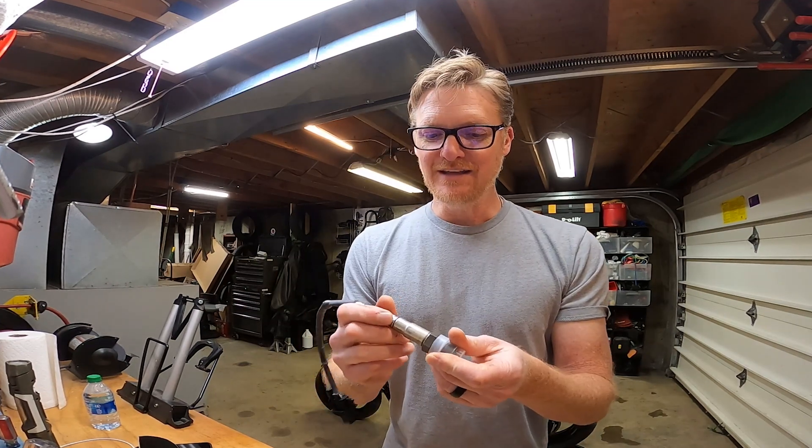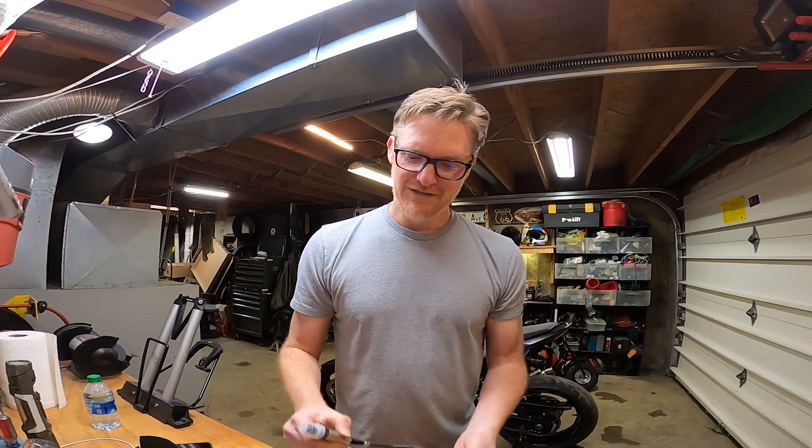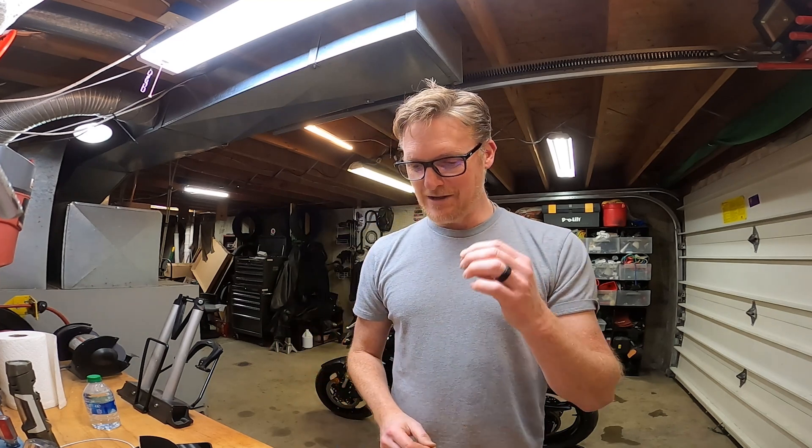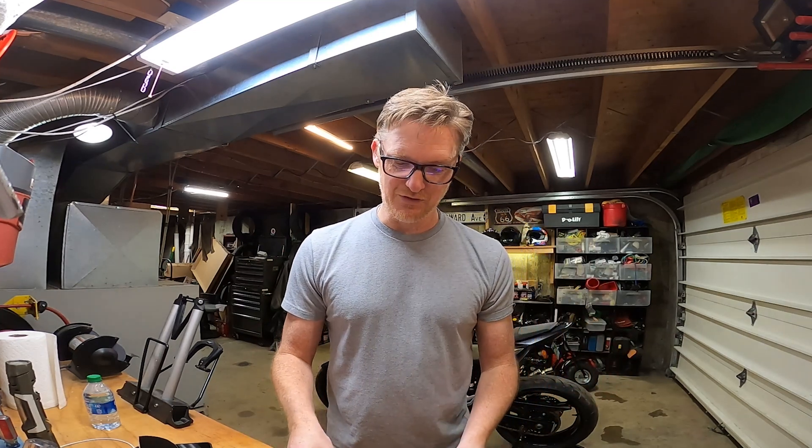What's cool about a wideband is that it has the ability to make very wide adjustments in your fuel curve. Whereas the factory one is really slow — it samples the exhaust less frequently, and it can only make smaller, broader changes to your fuel. Whereas this one is milliseconds quick, changing right on time, right when it needs to. Depending on RPM, it's not using slow-moving averages; it's tuning your fuel right now based on driving conditions and atmospheric conditions.